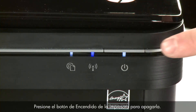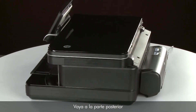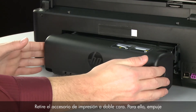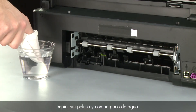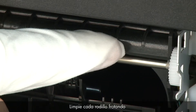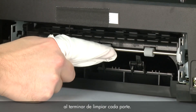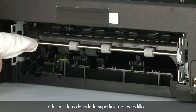Press the power button on the printer to turn it off. You don't need to turn off power to the control panel, as they are on different power sources. Turn to the back and disconnect the power cord. Remove the duplexer by pushing the right side of the duplexer to the left, then pulling it out. Clean the rollers visible in the printer with a clean lint-free cloth lightly moistened with water — the cloth should be damp but not soaking wet. Wipe each roller starting on the right side and wiping to the left, using your finger to turn the roller up as you finish cleaning each section. Make sure you remove any buildup or debris from the entire surface of the rollers.